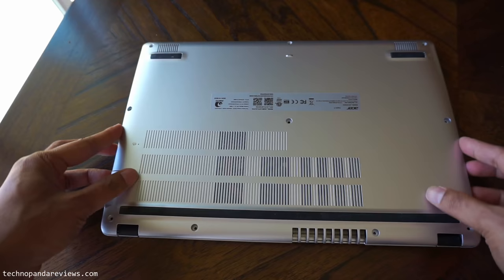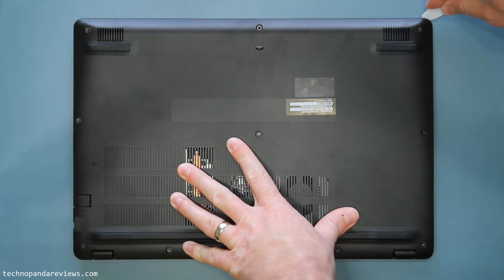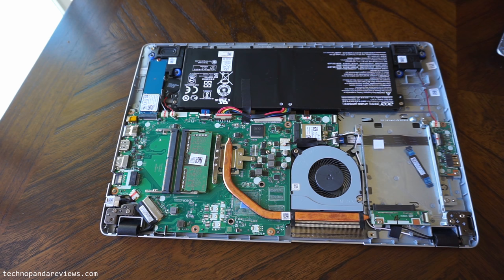Let me show you how to upgrade the SATA 3 drive. First things first, you will have to open the back of the laptop. If you have never done it before, don't be scared — it's not that complicated. Acer has done a good job when it comes to upgrading this laptop. You will see about a dozen screws on the back. Remove these screws, then take a plastic credit card or a plastic knife and gently pry open the back of the laptop, starting from one of the edges. Once you have removed all the latches, the back will come out.